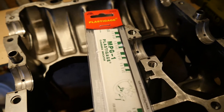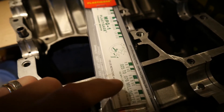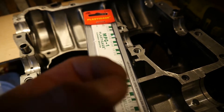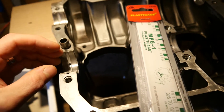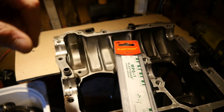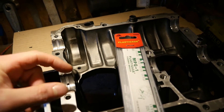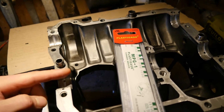As I understand it — and I have never done this before, so it's a learning process — Plasti-Gage is essentially very thin strips of a sort of blue-tack, plastic kind of material. You tear off a piece and place it on the journal you want to measure. You fit it into the crankcase so the plastic is sitting on top, and when you put the other half of the crankcase on and torque up all the bolts to the correct spec, the plastic gauge gets squished.